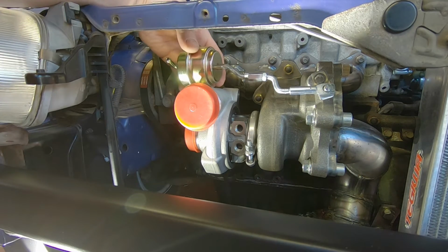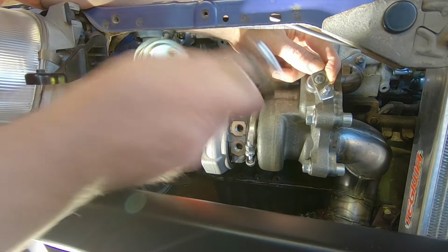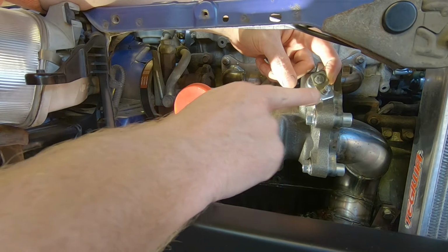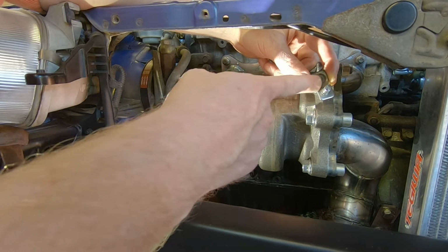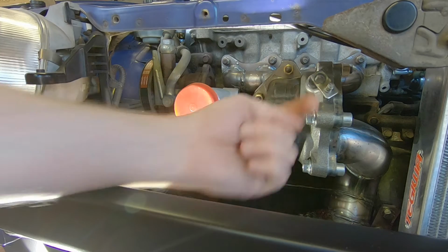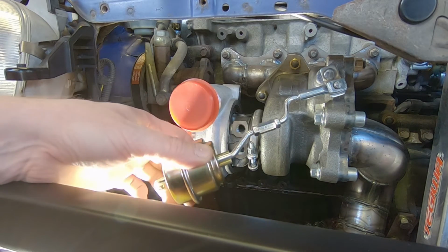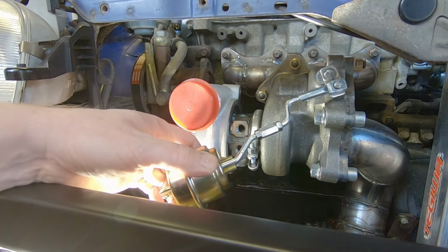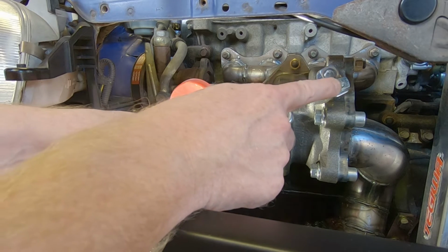but the problem is the actuator lever here at the back is off an angle. But if you look at it as well, the bottom plate here is slightly twisted back. It's intentional, it's not happened by accident. That's actually been done at the factory. But that means that this pin is actually at a slight angle backwards that way as well. So when we attach this, the original actuator would be here and it would be pushing basically set at sort of 90 degrees roughly to this lever.